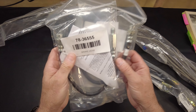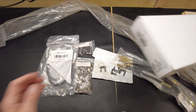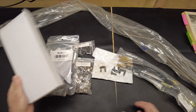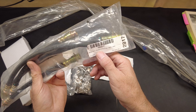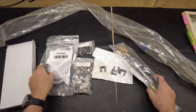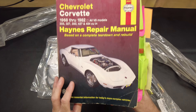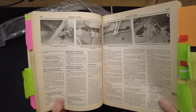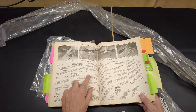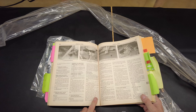I also have another set of front brake hoses — these ones are AC Delco. These ones I got from Corvette Depot: rubber, four pieces, 1963 to 1982 C3, so they will work. Once again there are other references, but primarily I like to refer to this book here. It has the general instructions on chapter 9-8 — replacement front brake hoses and metal brake lines — and that is what I'm going to do in this video. So let's get out in the garage and see how it goes.